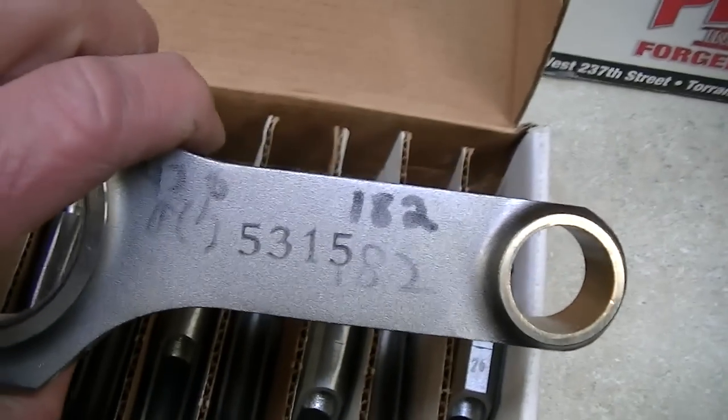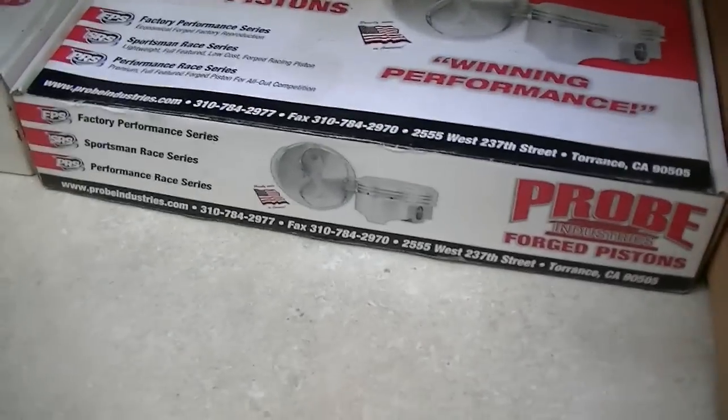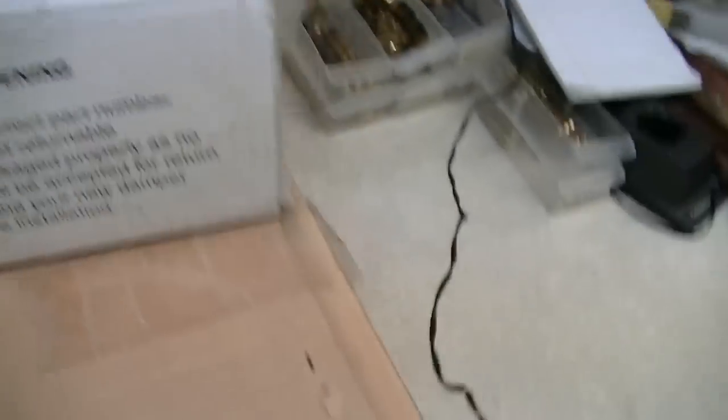All this stuff I've had for two or three years. I bought it all from a guy on eBay who was getting out of drag racing and into tractor pulling or something. I got a set of RPM rods, which are the rods featured in my rod bolt torquing video from last summer. I'm building a short rod 347 this time — 5.315 inch rather than a 5.4 inch rod. The reason being the oil ring doesn't get into the pin bore, so theoretically it's a little better on oil usage. This is the kit he had and I got a heck of a deal on it.